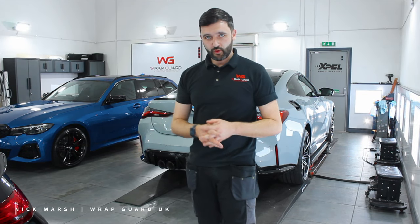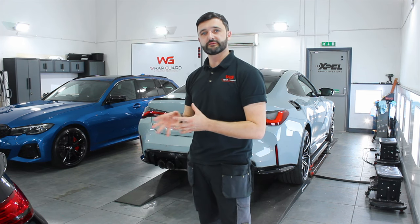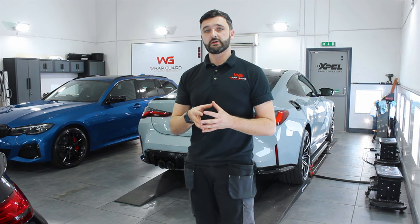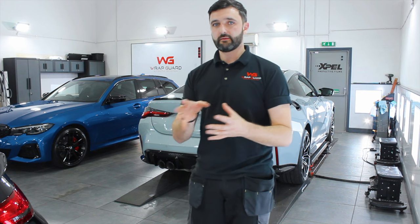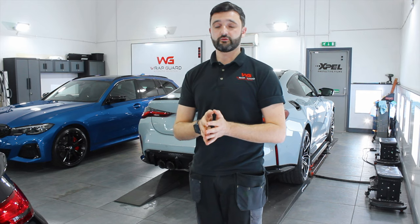Hi Craig, thank you for the warm welcome. Your viewer has a very valid question: does paint protection film give an orange peel effect? Traditionally yes, and there are still some films on the market that do — but with good reason. If you're filming a full vehicle you can go for a film that reduces the orange peel effect, films that have coatings in, or even change the color using a colored PPF. But if you're doing a front end — just a bumper or bonnet — you want to mimic the finish of the car, and most cars do have a full orange peel effect. So yes, there are films that offer that, but there are also films that significantly reduce it if you go for full car coverage.